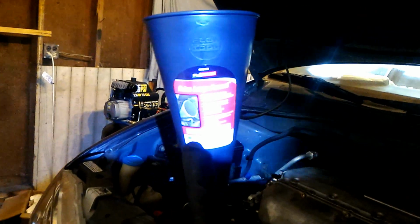Also, since this has the second gear lubrication update, that hose right there, there's no way to fill it from the original fill bolt, so basically you just have to jerry-rig something. This is vinyl tubing I got from Home Depot. I use this size, and then I use some pliers in here. I used a lighter to heat it up, and as it was heating up I would spread this hole with the pliers, then rotate it and keep spreading it. It keeps wanting to close, so you have to keep opening it every once in a while. But then it goes down to a thicker vinyl tubing, and then finally it goes into the funnel. And it's the same funnel that I've got right here. I just bought like three of them because it was on sale or something.